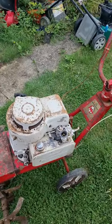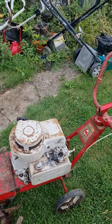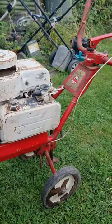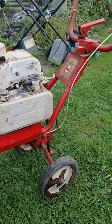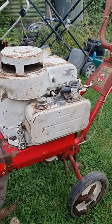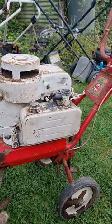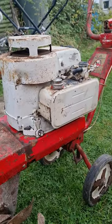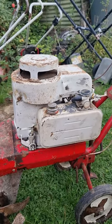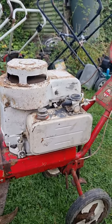I've just put it back together and I'll add some pictures of what it was like when I got it for £25. I've just degreased it, replaced the fuel pump, and fitted an electronic coil from a later 5 horsepower — this is our 13 series engine. It's had one over and the compression it's got is quite impressive. I checked it, pulled it, spluttered, and then first pull and it really went. I'm really impressed.